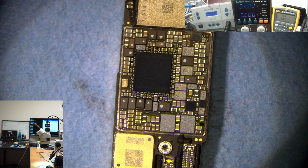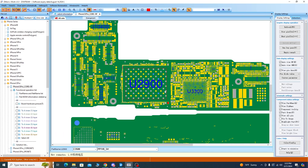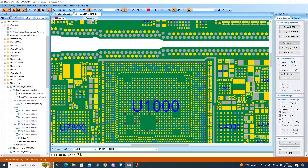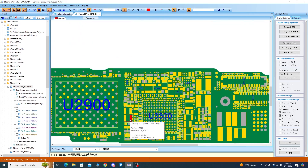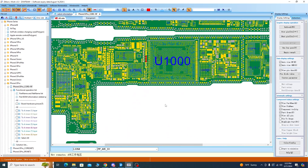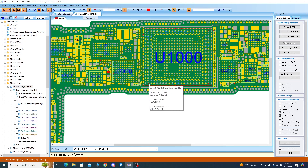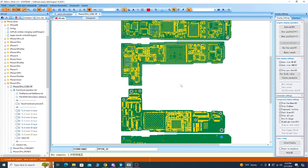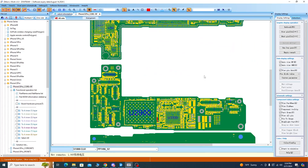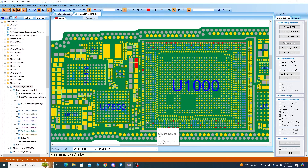Here's the PMIC, but we should take a look at our BoardView software. I have my 12 Pro open and we should look at as many power rails as we can. Typically I like to try to find any power rails that have a coil connected to the PMIC as well as the CPU — those in general are good lines to check. Other good lines are going to be RAM, so 1V8S2 is our RAM line, as well as 1V1 or 1V06.